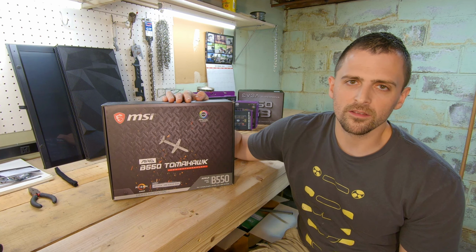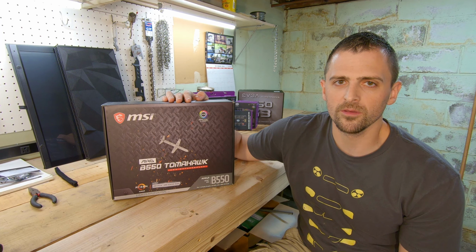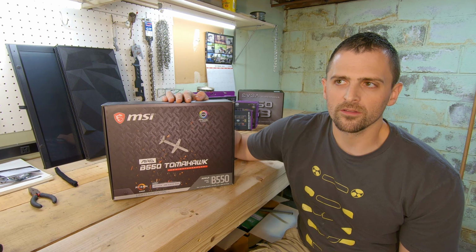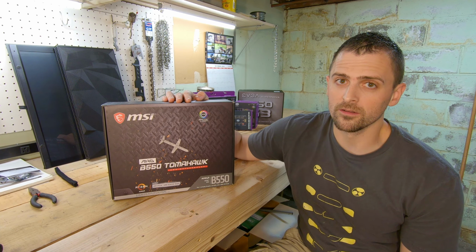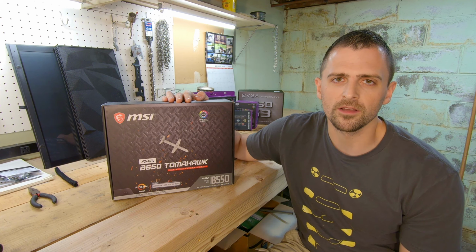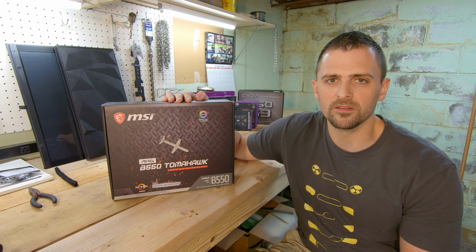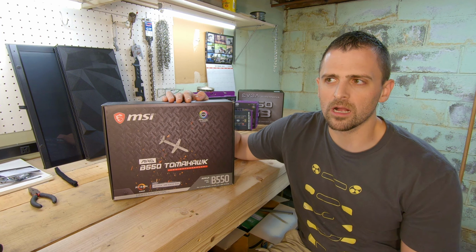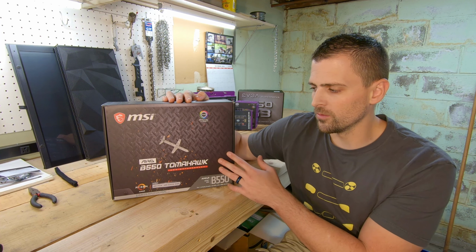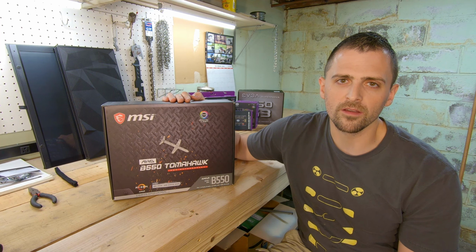My understanding is you can make the B450 compatible with the 5000 series CPUs, but at least what the research I had found said, it requires some fancy BIOS flashing and things like that. And this is my first sort of entry into PC building. It seemed like maybe it was a little overcomplicated for what I was going to be able to do. So I actually returned that, and we're going to go with the B550 here, because it's all set up and ready to go with the 5000 series